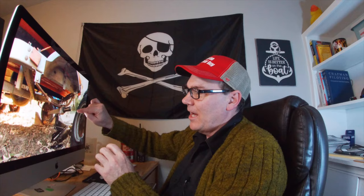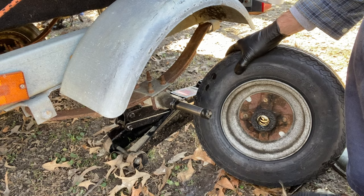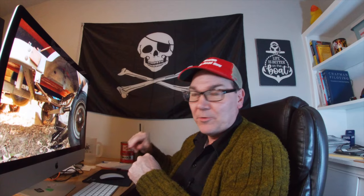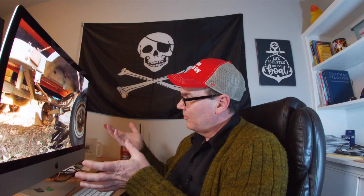There you can see the clean axle and the very back part where it's a little wider — that's where the axle seal fits. There's a lot of grease on this inner axle seal, which was one of the reasons I wanted to get into this. That grease has leaked out of the axle because the rubber seal on the inside is not sealing onto the axle as well as it should. That can let water into the axle and also let grease out — two things you don't want, especially with a boat trailer. We have to get that axle seal out in order to get the inner bearing out. What I've always found works quite well is a screwdriver.